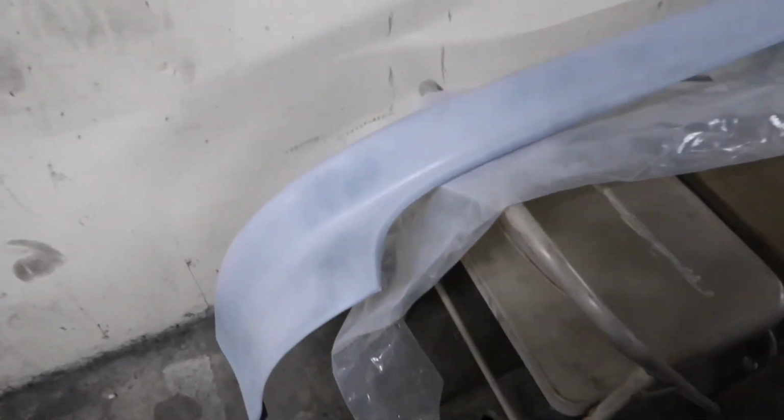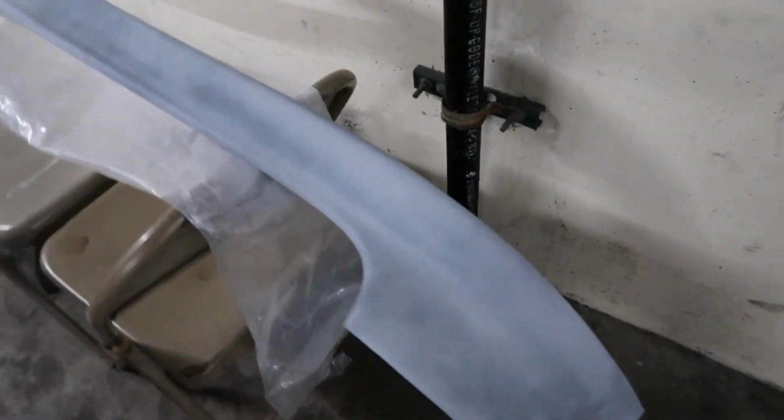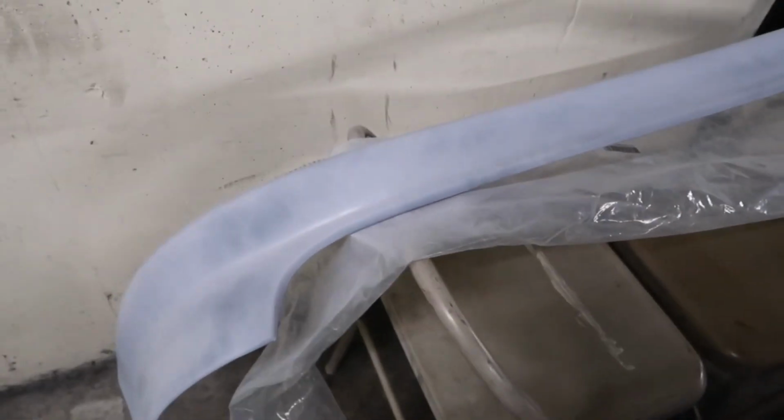Alright guys, so first coat right there, just let that chill. A very, very important step is to make sure that your primer is dry to the touch. It doesn't have to be 100% cured, but make sure that it already flashed off, nothing shiny, and make sure you get good coverage. I'm going to do 3 passes in total, then it's going to be base coat.